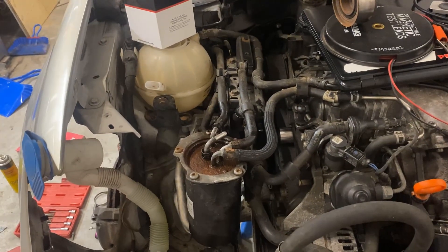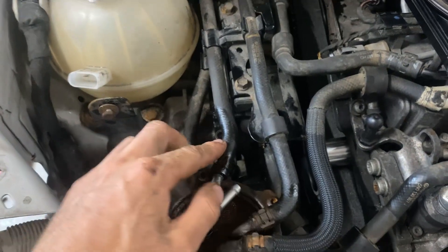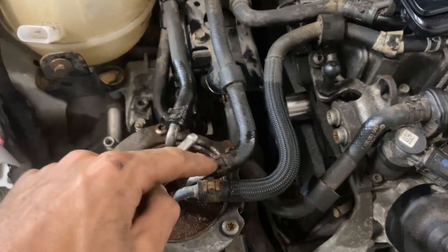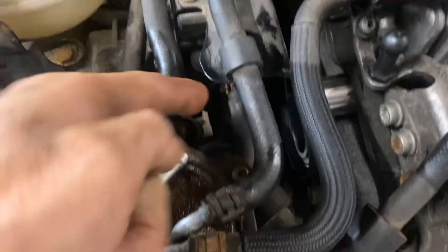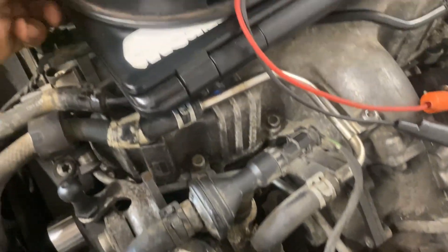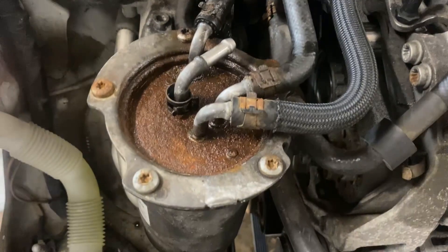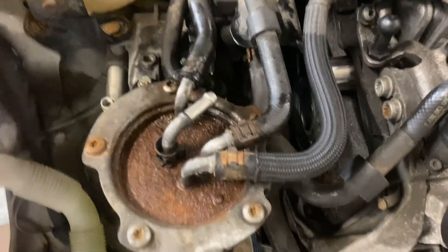Just doing a little bit of a layout of what all these fuel lines go to. We've got two lines that come from behind the coolant ball here. This one is your low pressure line — it comes from the fuel pump in the tank. This line that I have off also goes back there and would be your return to the tank. The third line goes to your intermediate or medium pressure fuel pump, which then has a line that comes off and goes to the high pressure pump. Any leak-off from the high pressure pump or from the injectors gets fed back into the pump via a T fitting — or back into the filter. So this is a bit of a warm-up circuit. If you live in a colder climate, the fuel coming from the injectors and the pump will be nice and warm, which should prevent fuel from gelling in the filter housing.